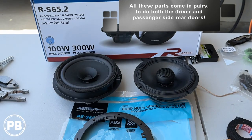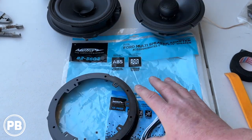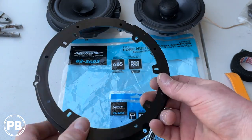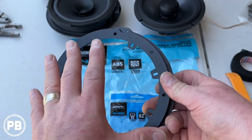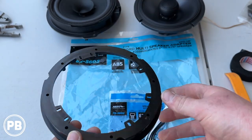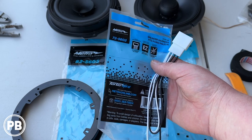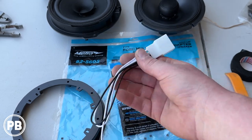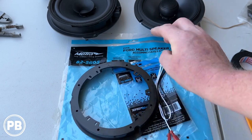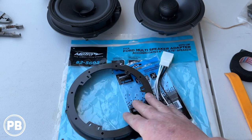To accommodate this new speaker in the factory location, we need a few adapter parts. The speaker harness adapter and bracket are by Metra. The bracket is the Metra 82-5605 — it accommodates both five and a quarter and six inch, or six and a half and six and three quarter inch, based on the bracket. We'll break off the inner tabs to allow our speaker to sit flush. For a plug-and-play application, we need the Metra 72-5602 harness adapter — one end plugs into the factory harness, the other into our new speaker. We'll break off the interior tabs, seat the speaker using the hardware supplied, and get this mounted in the door.